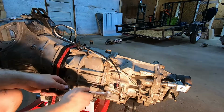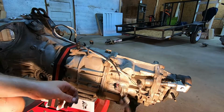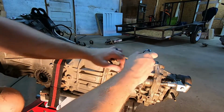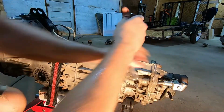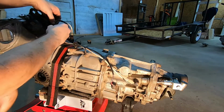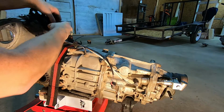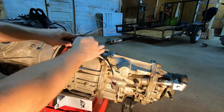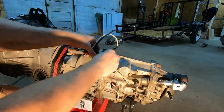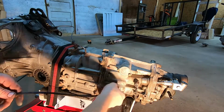All right, with the proper 19mm wrench, you can go ahead and get these off of here. I like to loosen them first, then come through and undo your connections. You got one up here on the pitch stop mount, one about midway here, another one here. So we'll go ahead and pull these out.